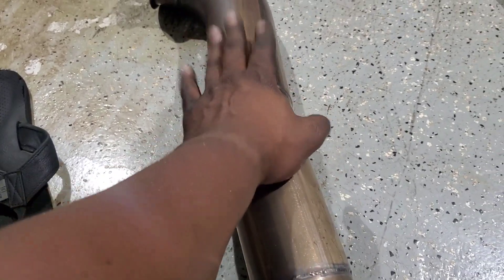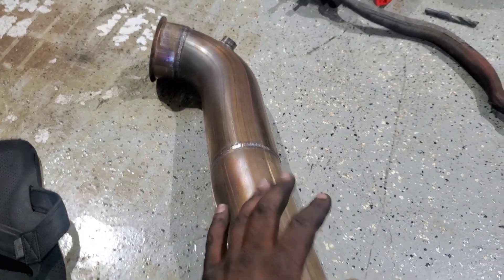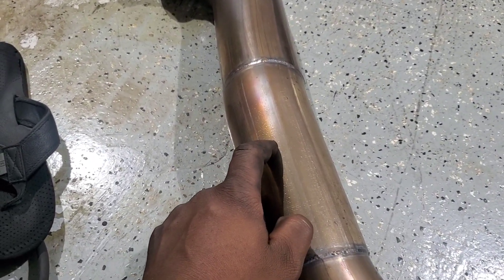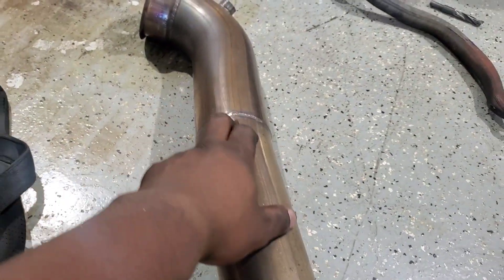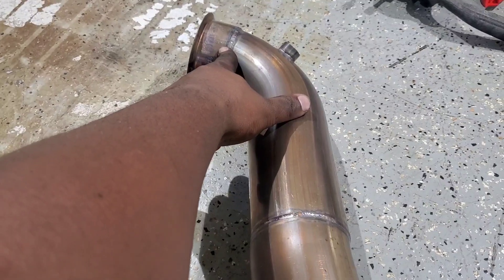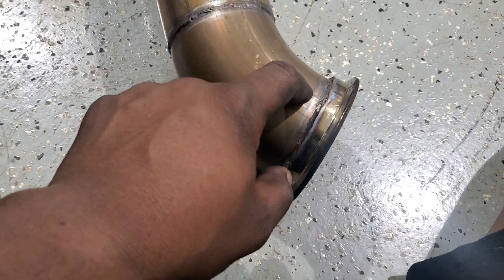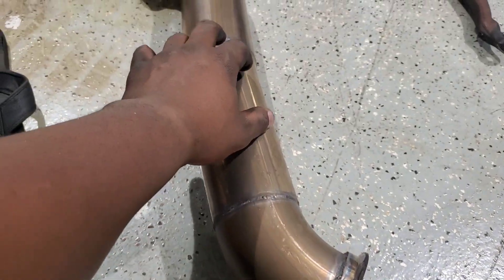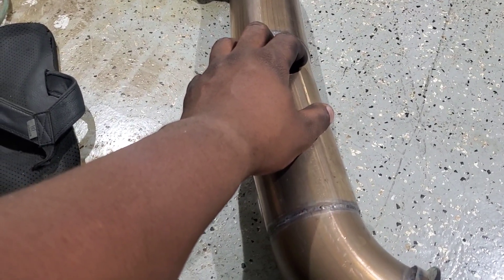The radius arm is on and the downpipe is out of the car. Here's the downpipe — three and a half inch downpipe. What I'm about to do now is wrap this with some heat shield. I'm gonna start wrapping right here, put a clamp there, and keep on wrapping it down. After you wrap it, it smokes — so that's gonna be part of it.